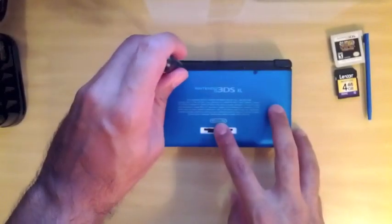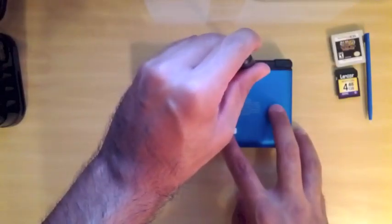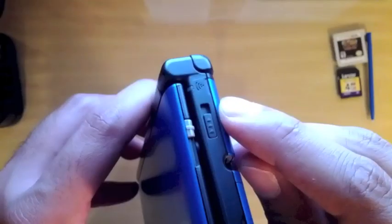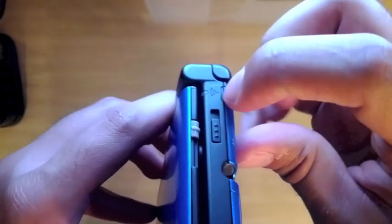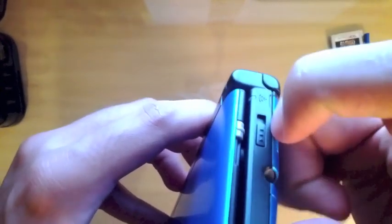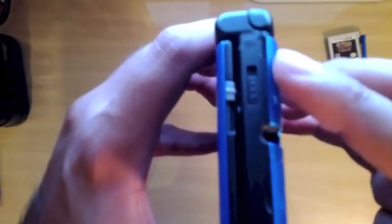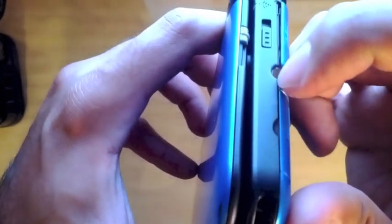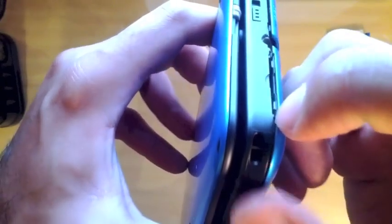Using a double-zero Phillips head screwdriver, we're going to take off the two bottom screws that hold the battery cover on. There's an indent right underneath the Wi-Fi signal area — the battery cover is just clipped on and snaps right off. Work your way from the back to the front of the battery cover, and do this for the other side as well.